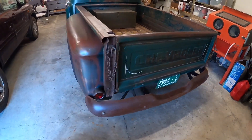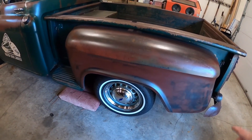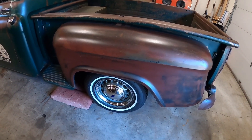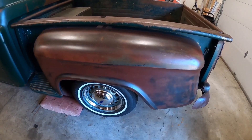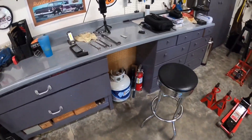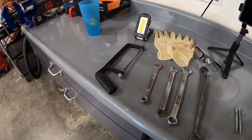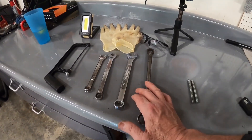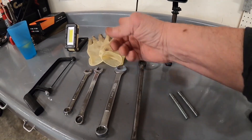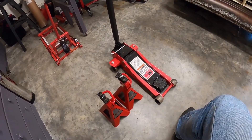We got her back on the ground — looking good. Changed those rear shackle capture carriage bolts. Did a nut-and-bolt check on the springs and the shocks — got a little tighter on those U-bolts for the springs, so glad I did that today. Pretty simple process. All we really needed was a cheap $6 hacksaw, a couple of 9/16 wrenches, a 3/4-inch open-end box wrench, safety glasses, gloves, and a light. These are the short ones we cut off. It's all good — happy to have that behind us.